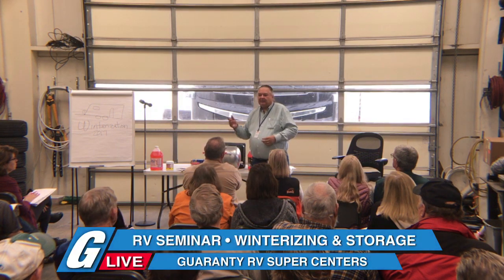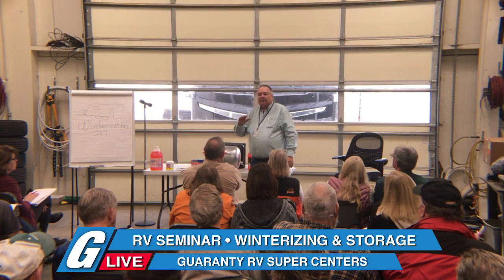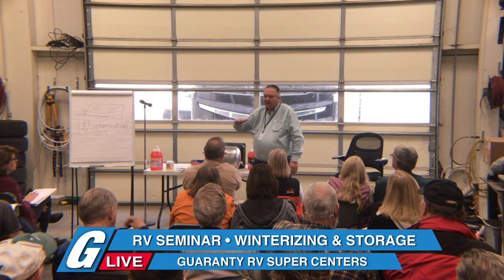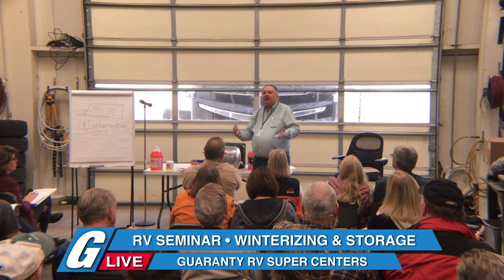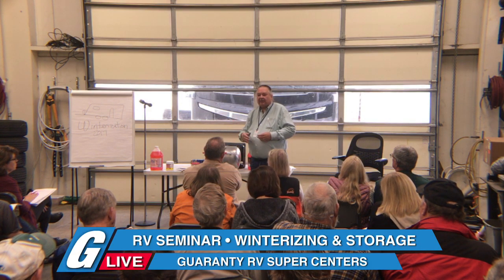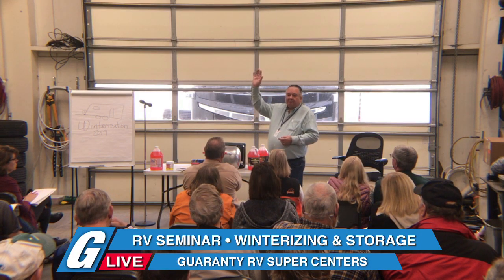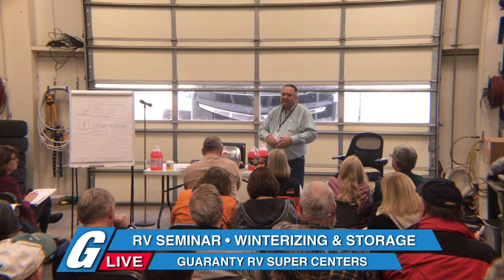The pressure regulators come in when you're in a campground where they have well water, and they turn it on and the pressure goes up to 90, and then they let it go down to about 30. And in the old campgrounds, that was really common. So everybody had pressure regulators to make sure that when the well pump was on, it didn't blow your plumbing. Nowadays, we don't see that very often.